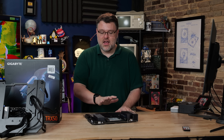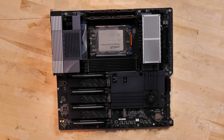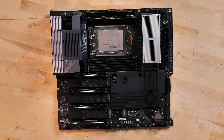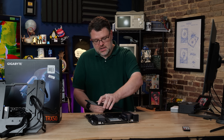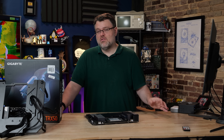In the box you've got a lot of stuff — we'll get to that. This is the motherboard. With a 9000 Series Processor, you get three X16 slots. If it's a Pro Processor, you get the fourth one. The X16 slots always have 16 lanes, but this bottom slot could be PCIe 4.0 x16 if you are using a 7000 Series non-pro CPU. If you are using a 9000 Series non-pro CPU, the bottom slot is actually capable of PCIe Gen 5, so you have four X16 PCIe Gen 5 slots.